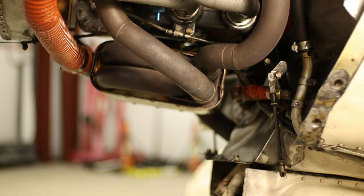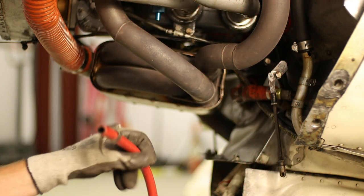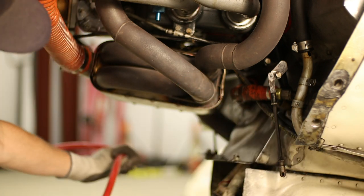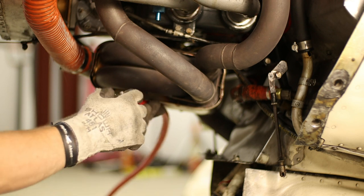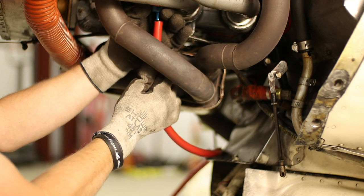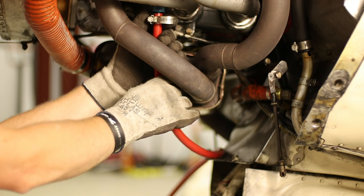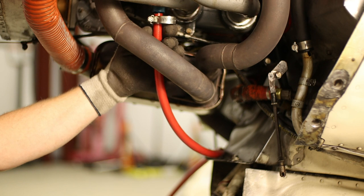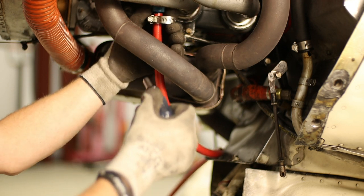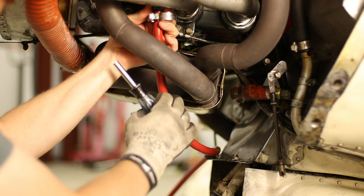The first thing I do after I have the cowling unhooked is take some 3/8 inch hose and use it to connect to my quick drain out here for the sump. I take the hose, run it out into the bucket, then run it up through here and slide it onto the quick drain. And then I have a hose clamp that I use up there to give a little added safety in case the hose was to come off of the quick drain.